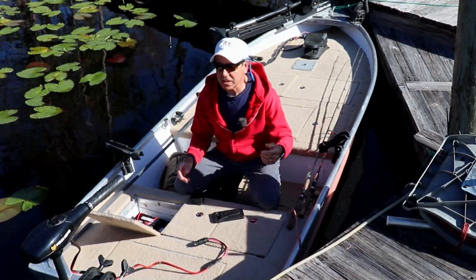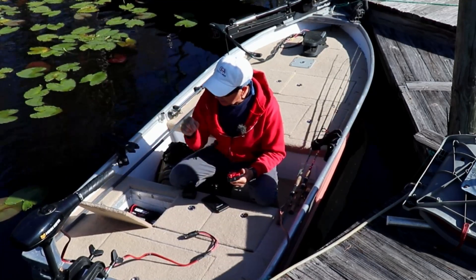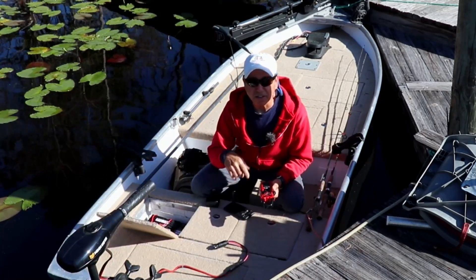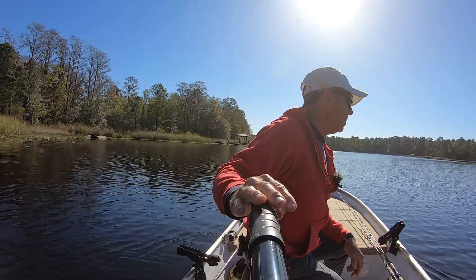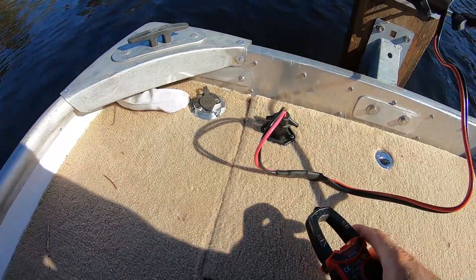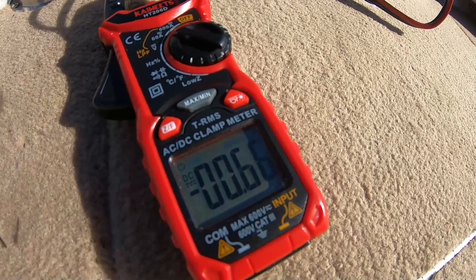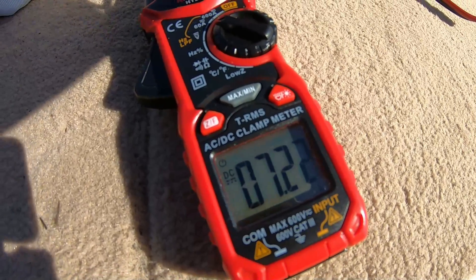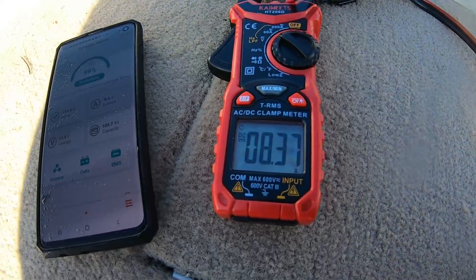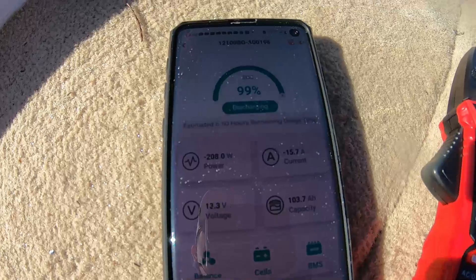My plan is to get out there on the lake, put some rods out, troll, and monitor the battery with the app. I also have my amp meter that I can put on the wire and we'll see what the meter says versus what the LithiumTime app says. Before trolling, let's clip on our meter — it's showing very low amperage just sitting there: 0.66. At speed one it's 7.16 amps; the app is showing negative 7.3. At speed two our meter says 8.38 and the battery is telling us 8.6. Speed three is giving us right about 16 amps, and the app is showing 15.7.